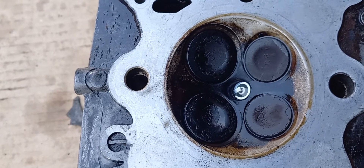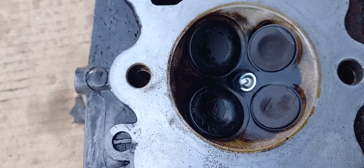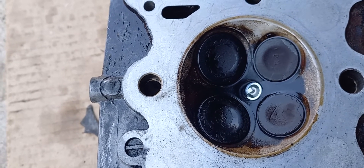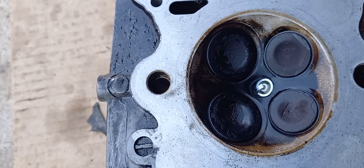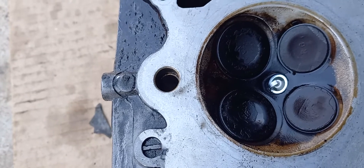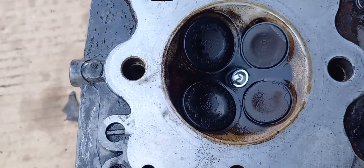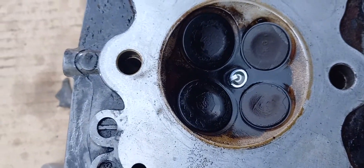Here's the thing - how do you know if you've got gas-tight seals on your valve seats? Well, generally you can fill the valve bowl up with some very light fluid like petrol, or gasoline whatever country you happen to reside in, or thinners. Because diesel is what I've been cleaning the engine with, I filled this up with diesel and it did not leak down. However, being a skeptical old hector, I'm now going to show you another way to check if you've got a leak.